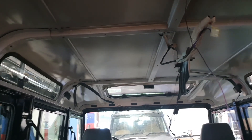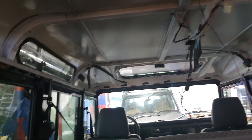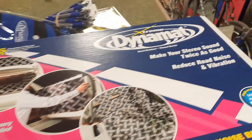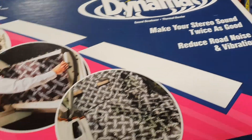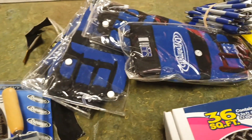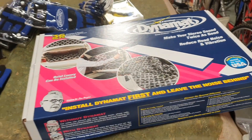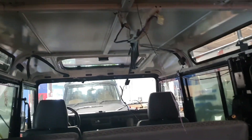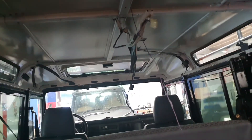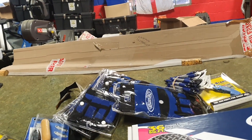The headliner is all out now. Next job is to carpet the headliner - we'll take you through that process, putting new carpet on the old headliner board. We're also going to do some soundproofing, and we're very lucky to be sponsored in this build by Dynamat. We've got several boxes of Dynamat to do this vehicle - it takes that tinny sound out of a Defender. It'll give us better sound deadening, making doors close with a satisfying thud as opposed to a tinny thud.